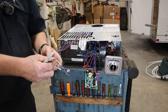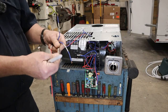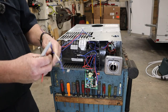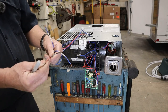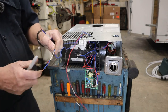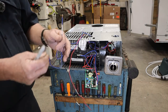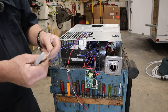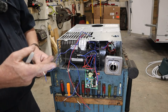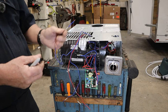Typically your furnace will have four wires. You're going to have usually a red, which is your positive, and a black. Most of the time you'll find a yellow wire or white wire — usually it's yellow — that's your ground. So those are your 12-volt ground and your 12-volt positive wires for your furnace. The two blue ones are your thermostat wires. Usually they are marked somehow — thermostat positive — and you just assume the other one's a negative. The red wire from your thermostat is typically positive, and the white one is the other.